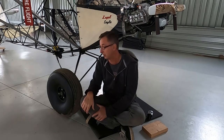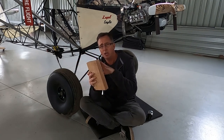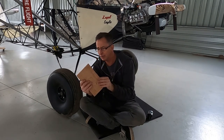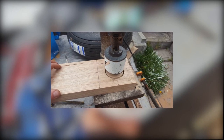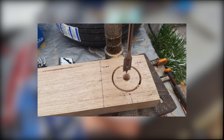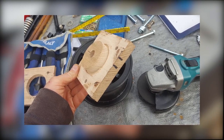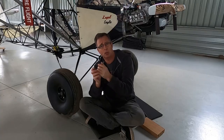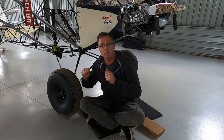Even under tyre flexing on a solid landing. What I started with was a piece of hardwood, roughly about this particular size. I didn't know how I was going to do it — all I knew was I'd experiment with hardwood, then have somebody turn out an aluminium spacer for me. Starting with a hole saw, I went halfway through the timber. A spade bit did the same right in the centre, then I used a jigsaw — a saber saw — to cut around the outside. That lifted off, leaving me with the very basics of a spacer. I then placed the disc rotor on top, making sure it was very, very central to the hole in the middle. After that was done, I got my bolts — I needed longer bolts than came with the Azusa live wheel, so I picked those up from the hardware store — put the bolts in and nipped it all up.